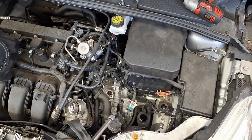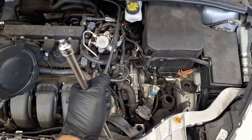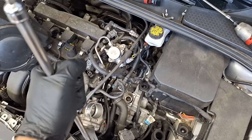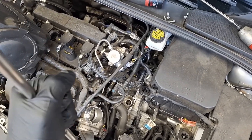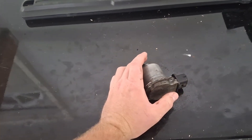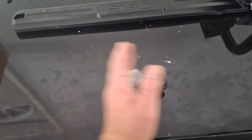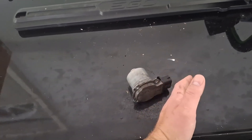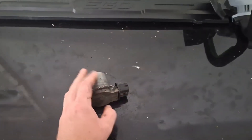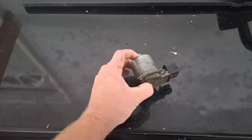This really isn't too bad of a transmission once you do the clutch job and replace the actuators and TCM. When you get the redesigned Ford clutch kit — which is a LuK repset, the OEM Ford parts — along with a new OEM redesigned TCM and new OEM actuators, you're going to be set for around 100,000 miles. The transmission may shudder occasionally after about five thousand miles, but it's not going to leave you stranded.